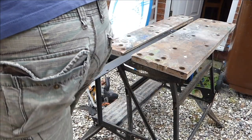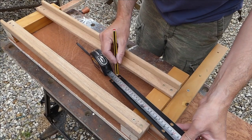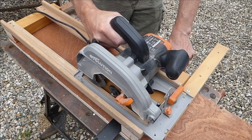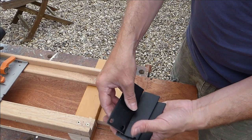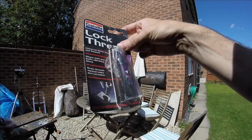What I'm going to do here is recycle an old shelf bracket, because I want to put on some really big plates underneath the roof rack. Instead of little tiny washers, it'll have really big plates so they don't pull back through the fiberglass roof. As you can see, these are going to be far sturdier than washers, so I'm pretty happy with these. I just need to drill out the centers so they'll accept the bolts, then lock thread the nuts on.